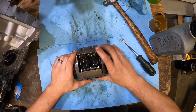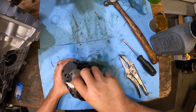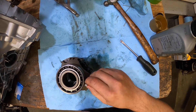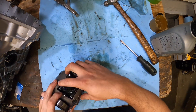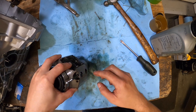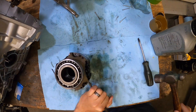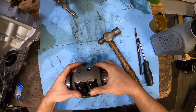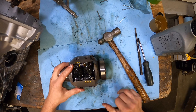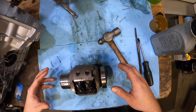Everything works, nothing binds. I'm going to put the last pin in — you just drive it in. One thing to watch when hammering the pin in is that the bottom main pin might want to walk out, so keep an eye on that and push it in as you drive the last one. There it is — the 4-to-1 center diff mod complete. All the alignment marks are where they should be and it's ready to go back in. Hopefully this helps some of you out there with your 4-to-1 mod — please leave some comments below!